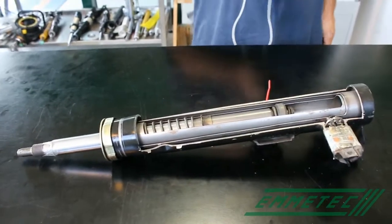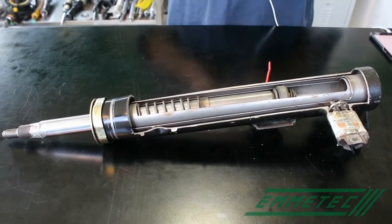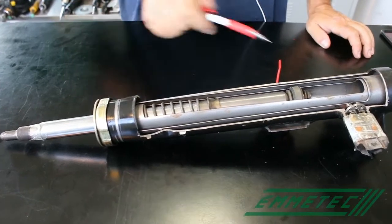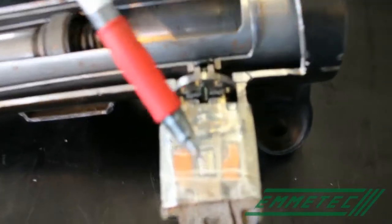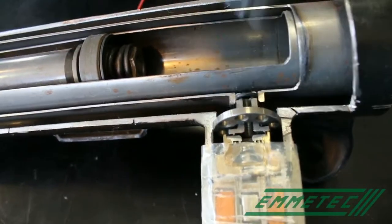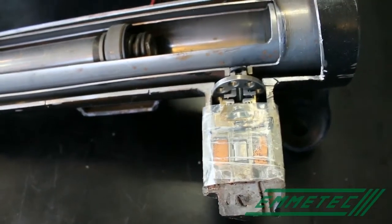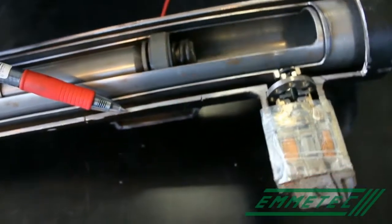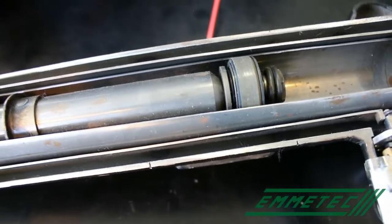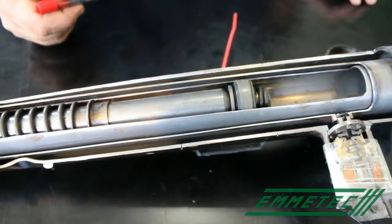The Monroe CVSA is a dual-tube shock absorber, electronically adjustable through an electronic lateral valve. In reality, if you open the shock absorber, you will see that there are 3 tubes, 1, 2, and 3, but it doesn't matter. We have to consider it as a twin-tube shock absorber.